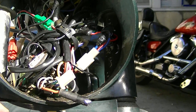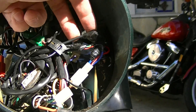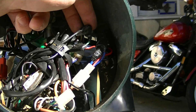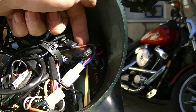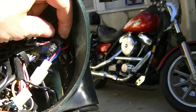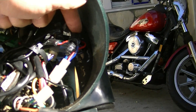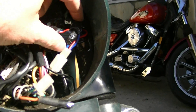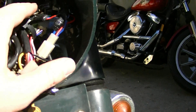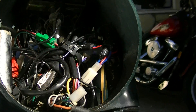So this is sort of a confusing mess of wires, but the green wire is connected to the wire I chose to run as black — even though it should have been green. So the green wire is connected to the black wire, which goes back to the negative terminal on the coil. The red and blue wires — red is power and blue is power to the light for the tachometer — I wired those into the blue wire on the ignition switch. It's pretty sloppy wiring, but it's secure and insulated. That way if I ever want to get rid of the tachometer, I can just buy a new ignition switch for less than ten bucks rather than cut into my existing wiring. The negative wire from the speedometer I wired into the black wire that goes to the instrument light, and it works pretty good.